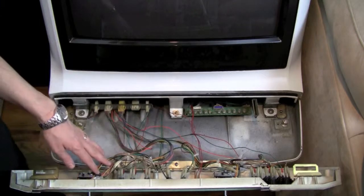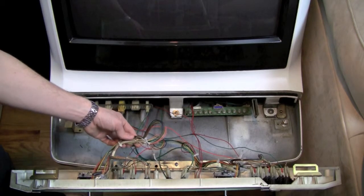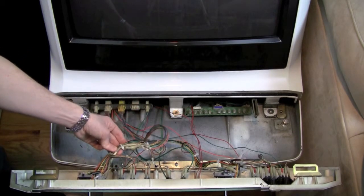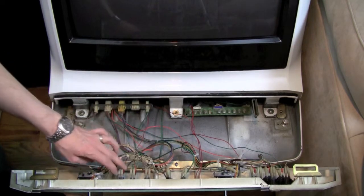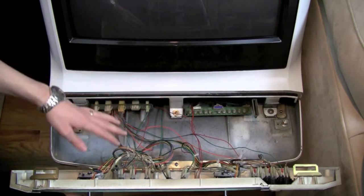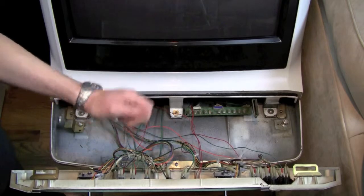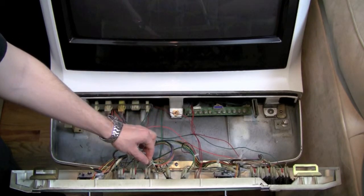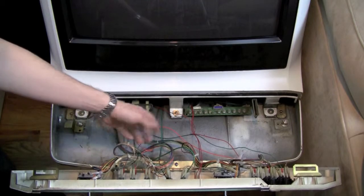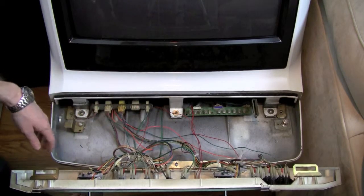You can see the wiring for all of the buttons here. If you're wiring up these buttons, all you need to know is you've got a ground signal — you can see it's this white one, this really dirty white one right here — that comes out from your JAMA harness. You actually just split it off and jump it to every single button. It's the same ground signal going to all of them. It sends a little signal to them, and when you press the button it completes the circuit. The other side is the connection that goes back to your JAMA harness on whatever pin that is — so player one, button one goes back to that particular pin. All of these come from the same ground. It's pretty easy to hook up, and you can use any of the grounds on the JAMA harness and they'll all work just fine.